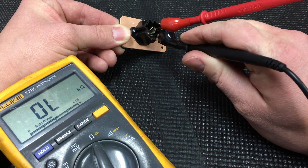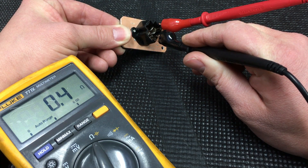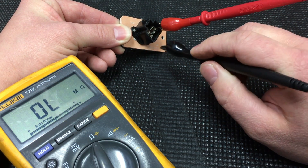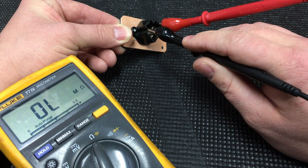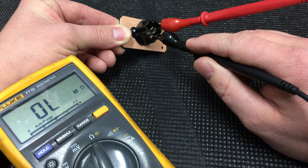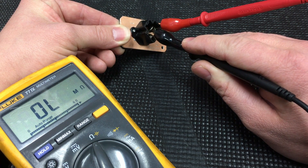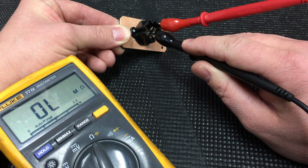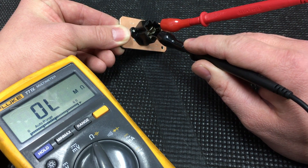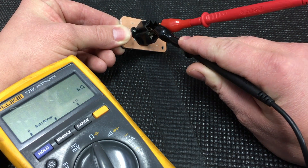And this one right here shows we have resistance through just the first one. What this does show is that each one of those resistors is okay, that the circuitry through the thermal fuse is okay, and also shows how each one of these resistance values achieves the voltage drop — and of course your blower speed drops based on each one of these resistance values.